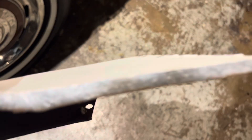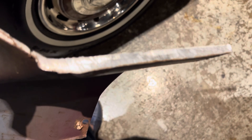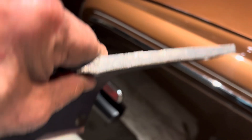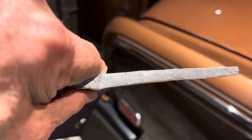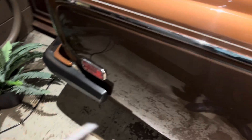What will surprise many is when I turn this over and show you just how much lead is actually in there. There's no wonder that you get this cracking issue going on. You'll actually see that is about half an inch — or very close to half an inch — of lead at the joint.